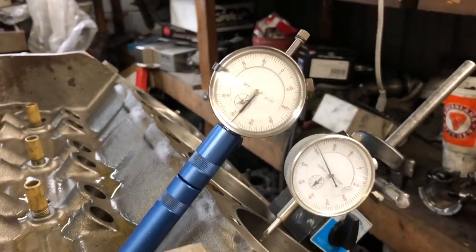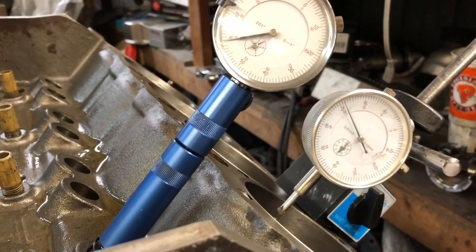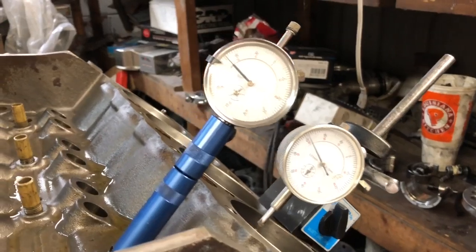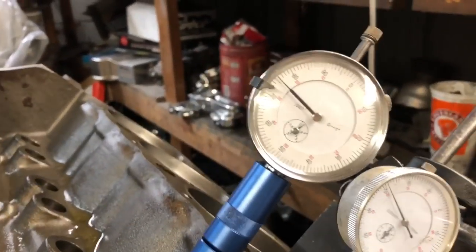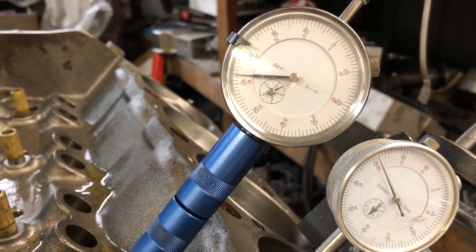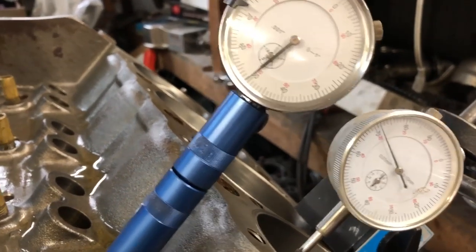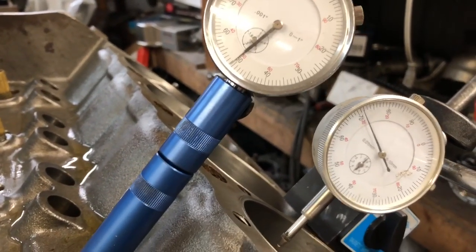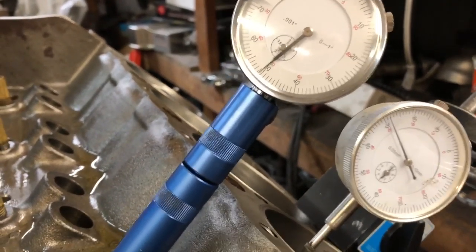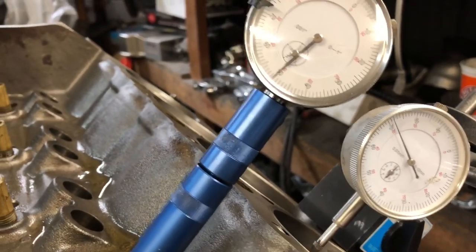It's biting again — I keep jumping past it. I guess I get a little twitchy with it as I get close, which happens every single time, which is actually kind of odd. You could do this at 40 thousandths instead of 50 — you don't have to do it at 50. If there's a bad spot on the camshaft I could go a little bit past, but I have to do it consistently every time. That's the key thing.